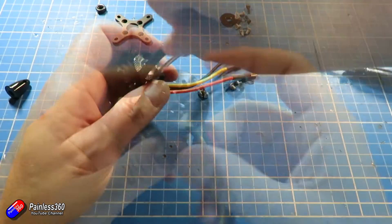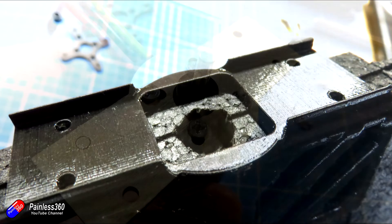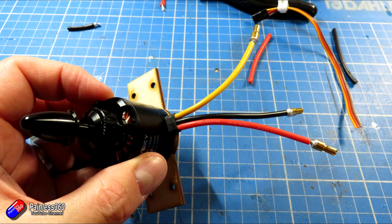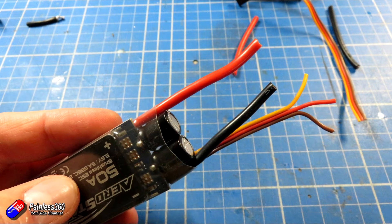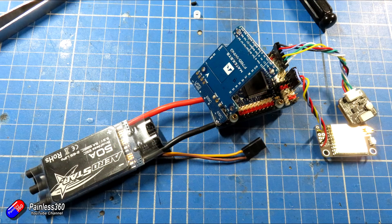Next job is to put the motor on. The motor mount is there — I cut out the relief hole for the shaft at the back of the motor and then screwed it into place. I then cut the motor wires a little bit shorter so there's not lots of spare wire flying around. I may need to swap a couple of the wires over if I need to reverse the motor direction later. With that done I can clip the wires to length, pop on a servo connector for the lead, and cut out the red wire for this ESC. The battery eliminator circuit will still be running, but because it won't be supplying any current it won't be generating and dissipating heat.